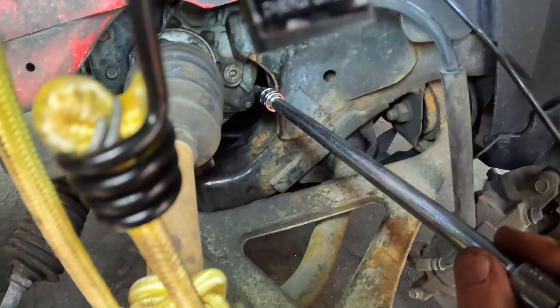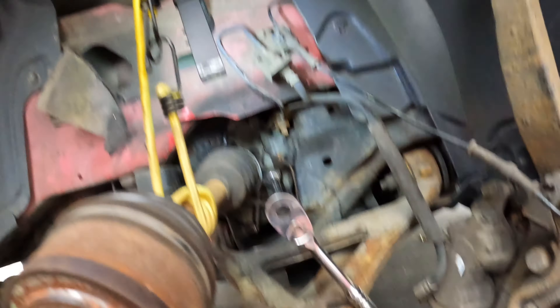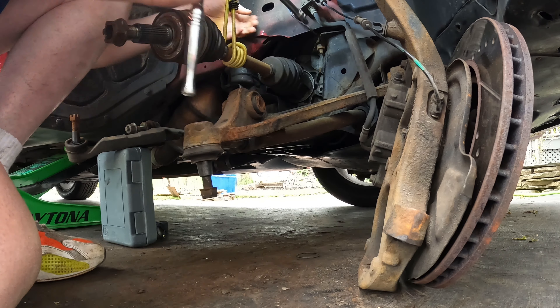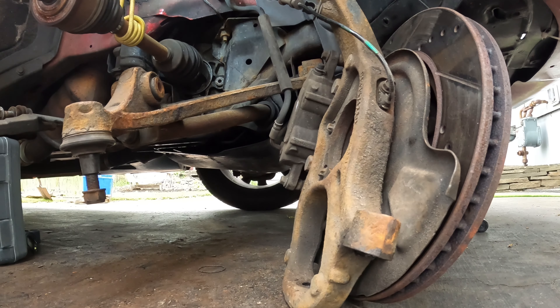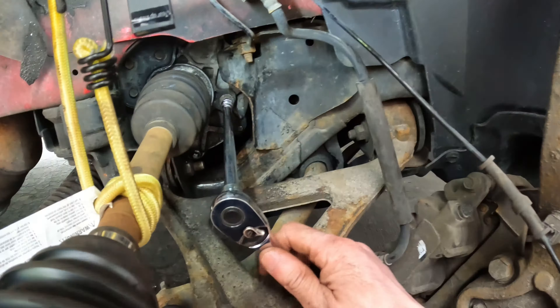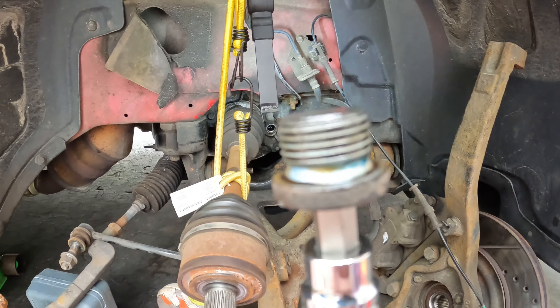Next up, take your 8mm hex — you guys see that bolt right here. This is going to be for the gear oil. Let me use two hands to take this off. That is stuck — breaker bar time. Grab your breaker bar, see if I can do this with one hand. I just broke it loose — I didn't capture it on camera but you guys heard it. This is probably going to be a longer video. I'm doing the front today and probably the rear another day for a different video.